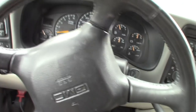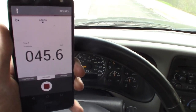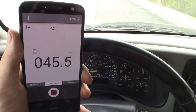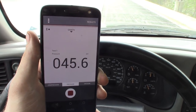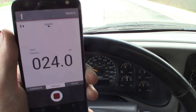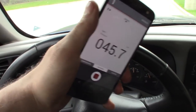Pretty nice — accurate. I noticed one thing: it only gives you a certain time to connect. A little screen pops up saying connection time disabled or ran out of time, so you got to hit the reconnect button, the Bluetooth button again. Floor it — seems like it takes right here, I'm starting to lose power, down to basically no fuel pressure at all and I got it floored. Definite fuel pump issue here. Easy way to find out, great use of the tool. I got the hood shut, no lines or wires sticking out.